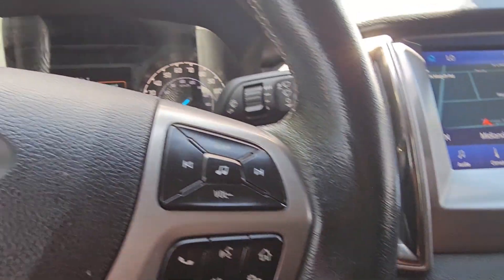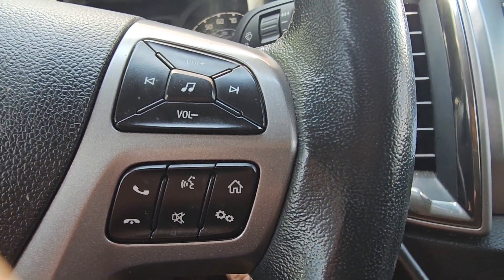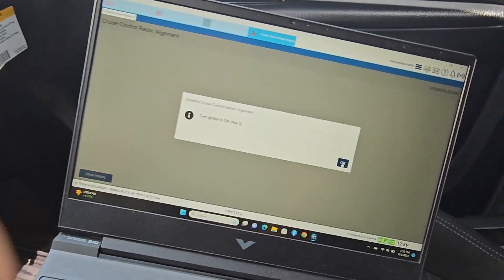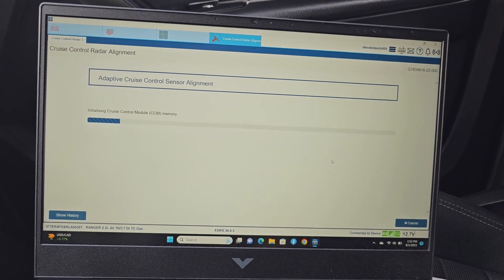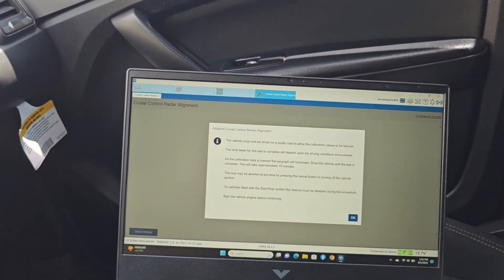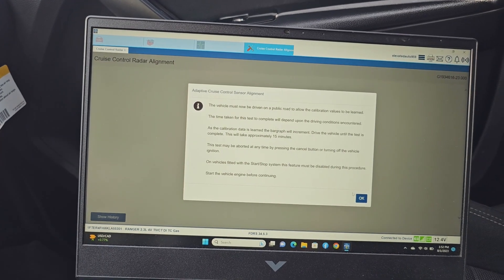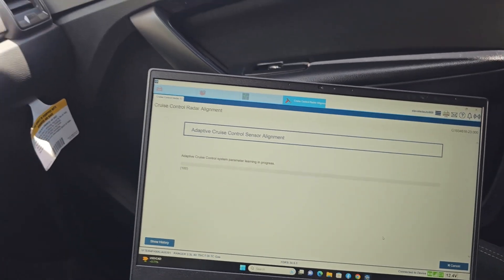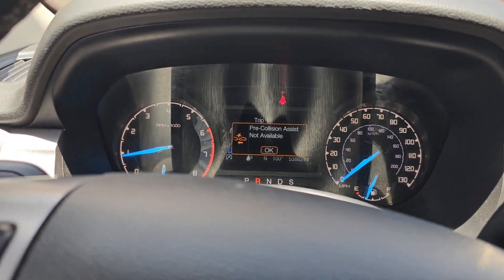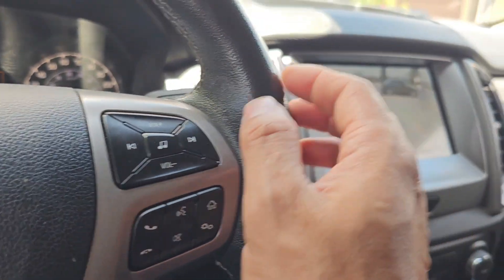Position two — we have the vehicle running because it's pretty hot outside. Let's just have it to ignition on. Turn the AC off, hopefully it'll let us finish pretty quick. Must now be driven on public road, new calibration values learned. Start the vehicle before continuing. Okay, learning in process. Front sensor not calibrated. Let's run the AC on max and go drive this thing.